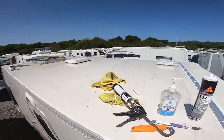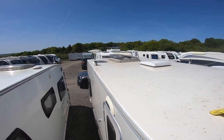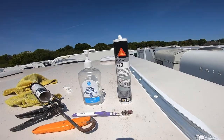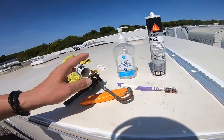Job done. I've done both straps going across the front and rear, all down the sides, the aerial, and the gas outlet vent. I still need to do the openings for the other vents — that'll be another day. Like I said, it's not the prettiest, but nobody's going to see on the roof and it's doing a job. The things I used were Sikaflex 522, a bit of hand sanitizer to clean the surface for good adhesive contact, a Stanley knife when needed, a toothbrush for getting into those little gaps, and obviously a mastic gun. Hopefully that'll keep the water out for a few years. If you enjoyed this and found it helpful, I'm really pleased. If anybody's got any better ideas, please leave comments below and help other people. Cheers, thanks guys.